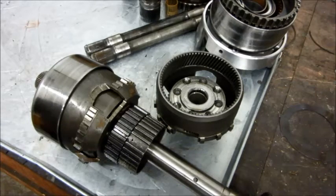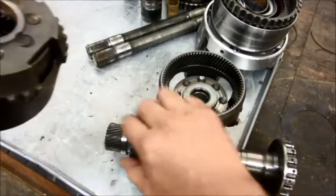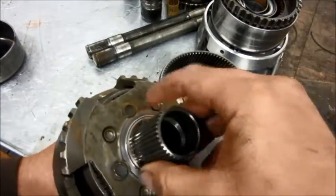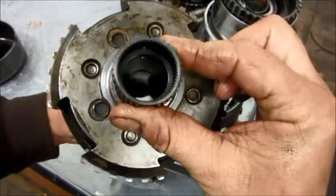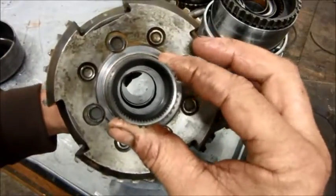Get it on the freeway at really high speed sustained and it will help it hold up. The plastic lube dam comes right up to the edge of that bearing, and when the sun gear fits in there and it's all pressed together, it's more or less one continuous tube all the way through. It's a very worthwhile modification to have.